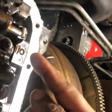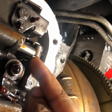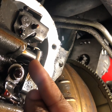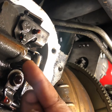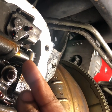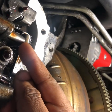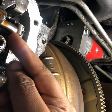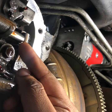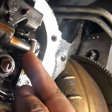That cable moves this plunger with this lever backwards or forward. The best adjustment is you want no slack here. This is the plunger that controls the pressure of the transmission for shifting, so you want no slack between those with your adjustment. I was trying to do it by feel and it cost me. Best thing to do is drop your pan and play with that cable until you get no slack.